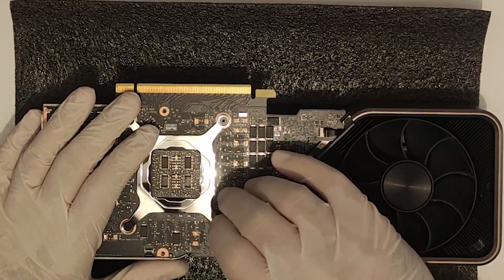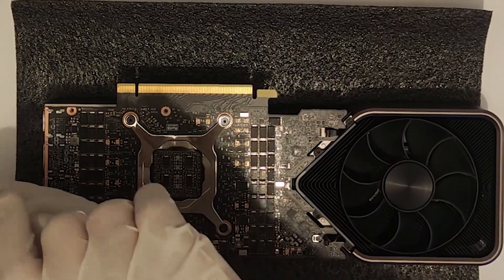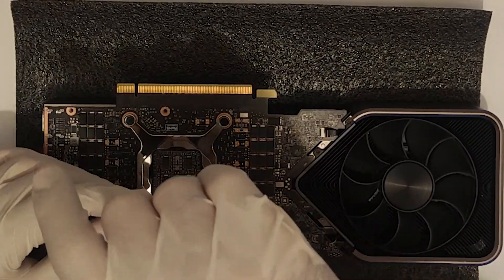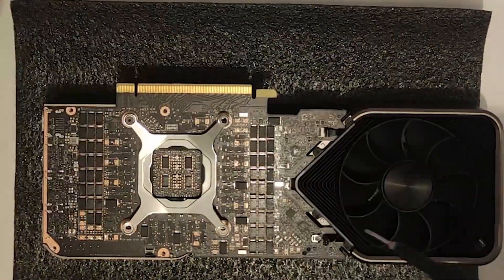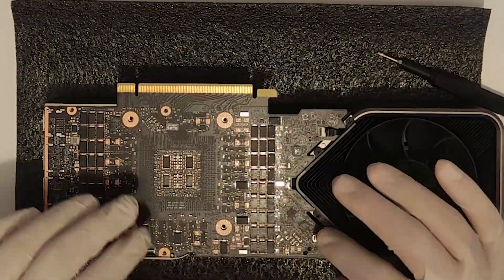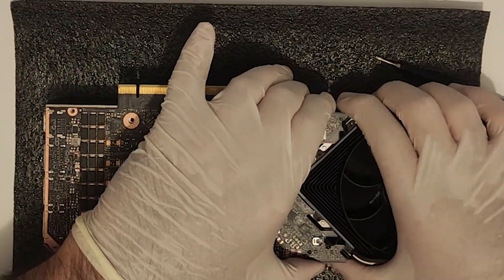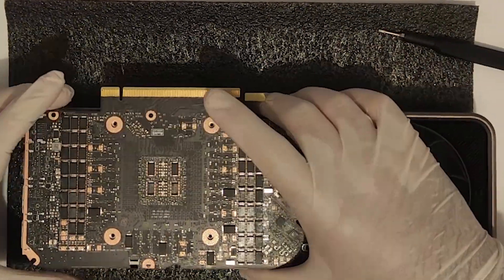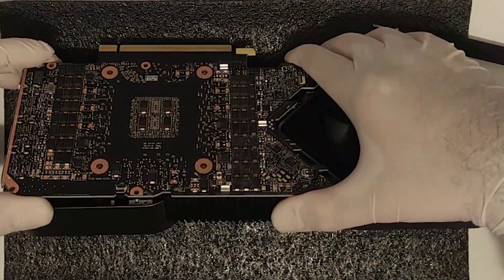It was just a matter of removing the leaf spring and freeing the PCB from the cooler. Do not take each screw out all at once as you might apply uneven pressure — there is potential for damage on the GPU die and then it's game over. Start with one screw and work in an X pattern until they are all unfastened. At this point the only thing keeping the PCB attached to the cooler is the thermal compound and the thermal pads. It will provide decent resistance so don't rush; use the weight of the cooler to separate the two. Gently wiggle the PCB side to side but don't be aggressive, and whatever you do, don't pry it off as you might destroy internal traces.